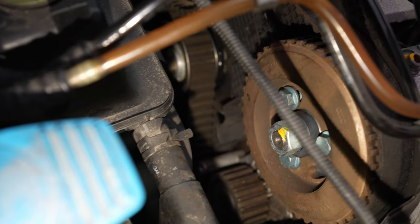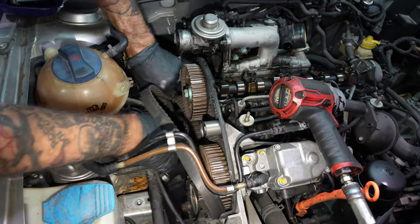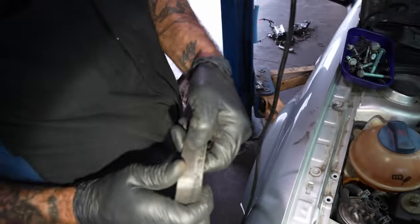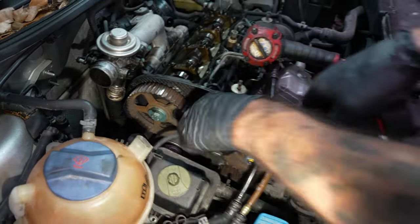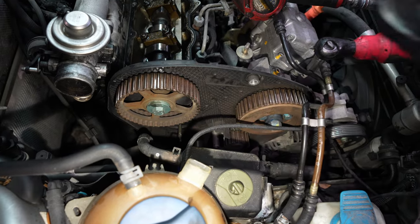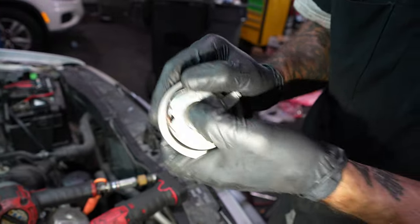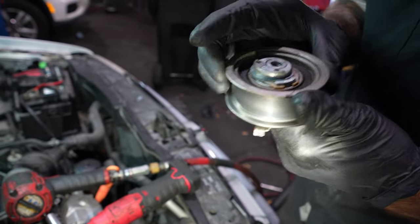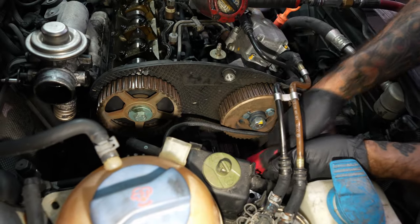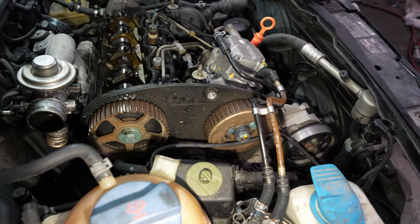That notch right there — it can be avoided, it's just plastic. Tensioner has failed, so we can just take this belt right off. You can see where it's been getting killed bouncing around. This is where the tensioner failed — right there. I don't know if this is an installation error or what. It's a quality tensioner, factory. Maybe it wasn't torqued to spec — it could have loosened up because it wasn't in the zone, sat there and rolled on it, could have been over-torqued.